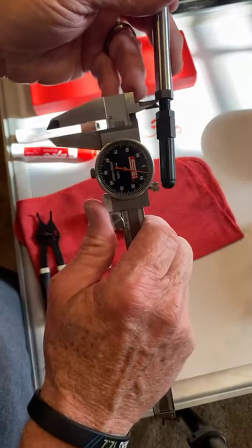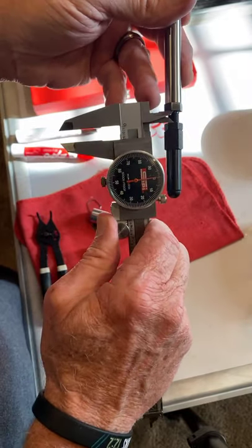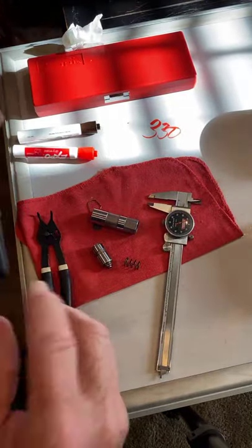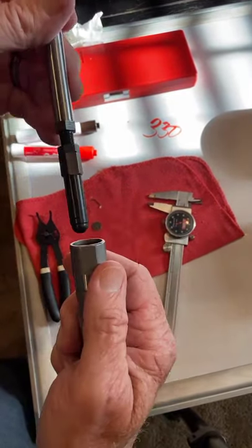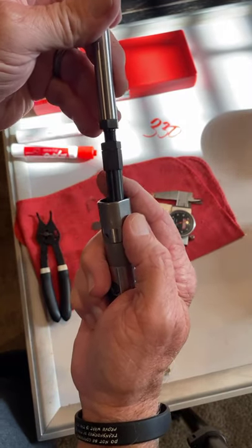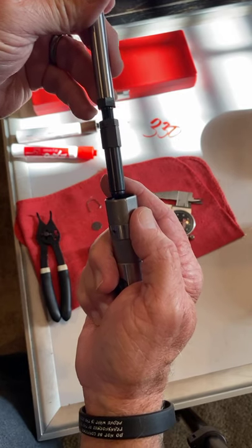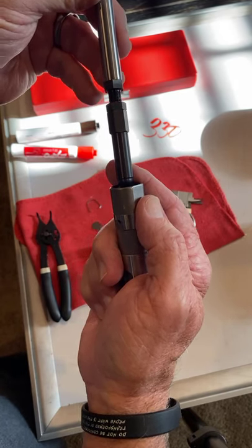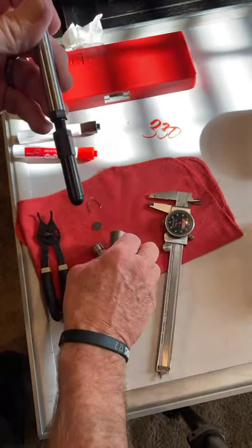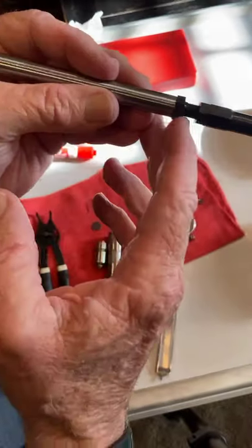I was at 200, and now I'm at 300. So what I did was I set this to where the travel in this lifter wouldn't be at the top, and it wouldn't be 200 at the bottom; instead of being at the top, and it has the travel built in to go down 200, I set it at 100. That's what this is for, how many threads per inch we can use right here.